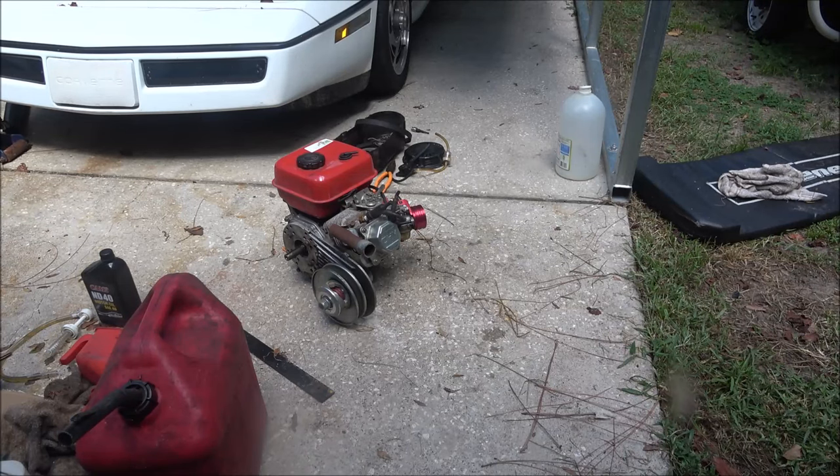Alright guys, I've got a FedEx delivery I'm waiting on, so we'll see if that's it — if so, it'll be another video. Okay guys, so it runs! It's been sitting for about three years, and it started up pretty good. It runs best with the choke halfway, so I either need to adjust the carburetor, clean the carburetor, or probably put a bigger jet in it. But yeah, I still have the governor hooked up to it, and it's pretty peppy. So that's going on my Coleman — stay tuned for more videos on that.